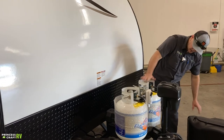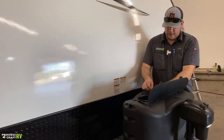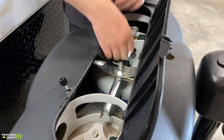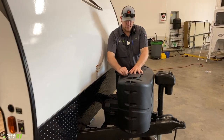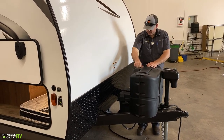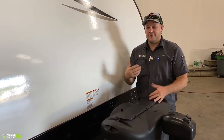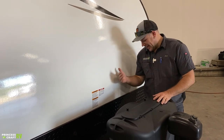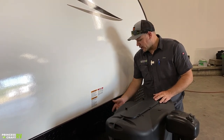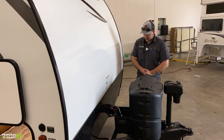When you're done, put the cover back — it slides right down over. Fish the velcro strap through the slot at the top, strap it back to itself, and close the lid. Don't forget to snug the thumb nuts down or the lid will fly off while traveling. Inside the battery box you'll find an Interstate Group 24 RV marine lead deep cycle battery that needs to be checked periodically for water level. Use distilled water to top it off. There are only two cables: red for positive and white for negative.